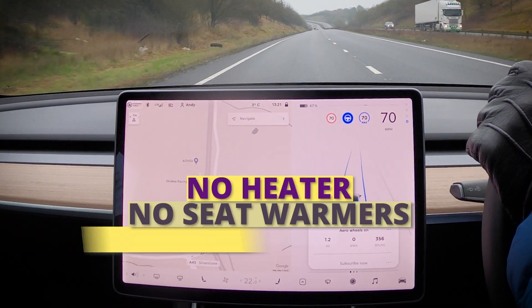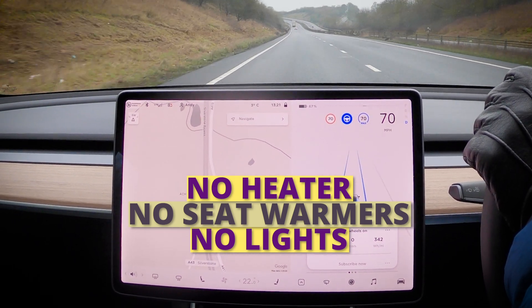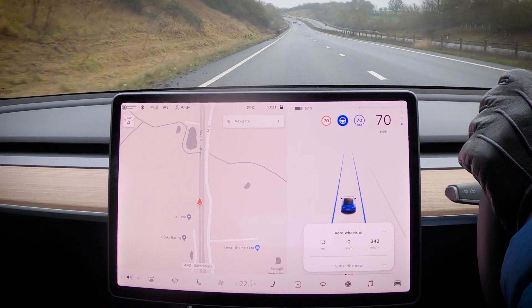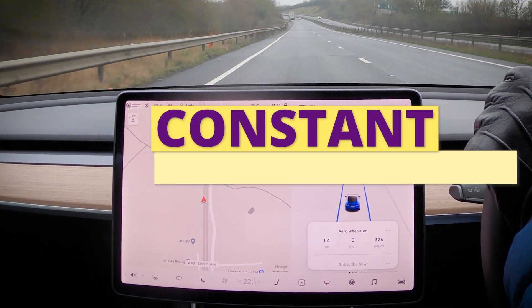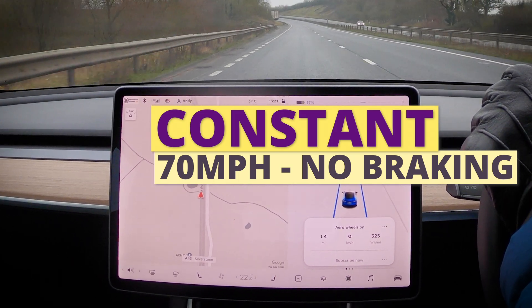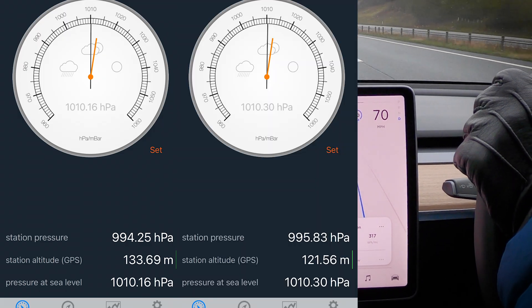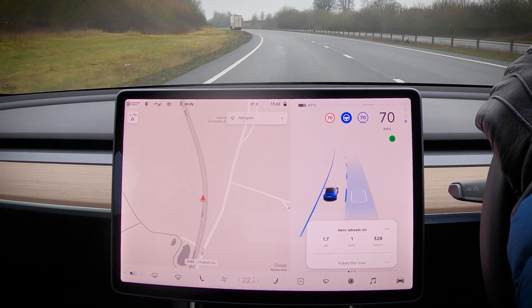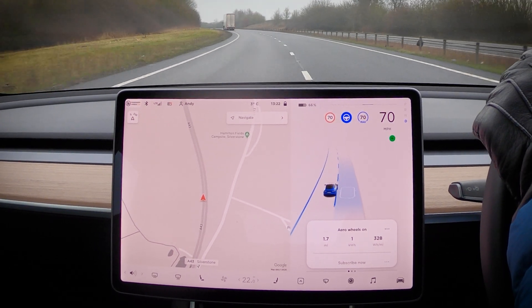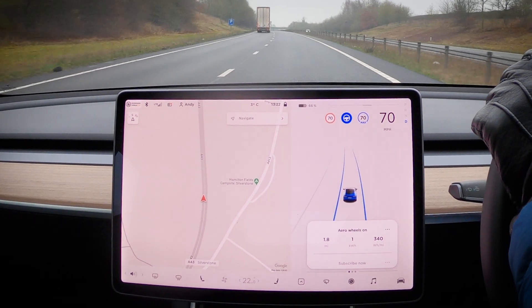I had the heating off, lights off, even the windscreen wipers, to eliminate the effect of regen braking and acceleration. Measurements were taken between two points when the Model 3 was at 70 mph, and due to no traffic we never dropped below that during the entire test. I didn't even notice any regen braking going downhill. I also made sure I never slipstreamed any vehicles. I measured the air pressure throughout and there were very little changes, and although it did start to spit with rain a little bit, it was about equal on all runs. I think I've covered every variable I can think of to make sure the only difference between runs is the aero wheels.